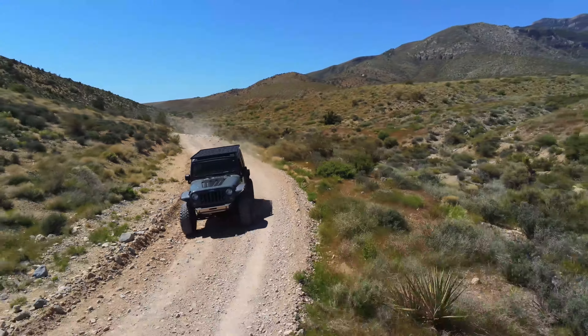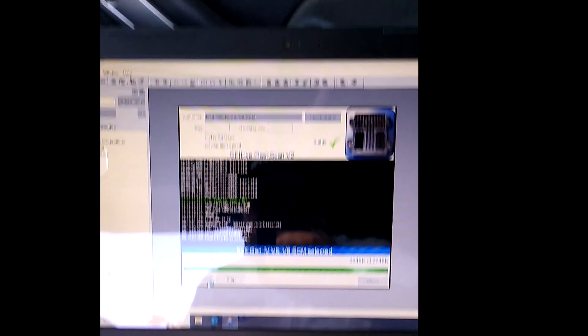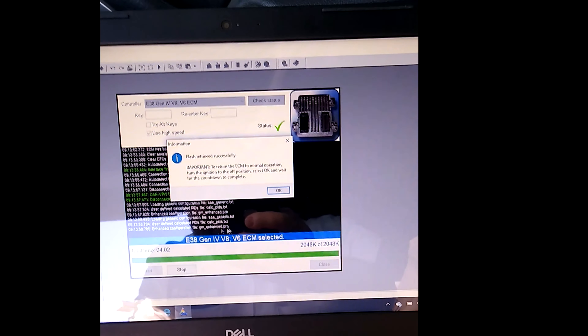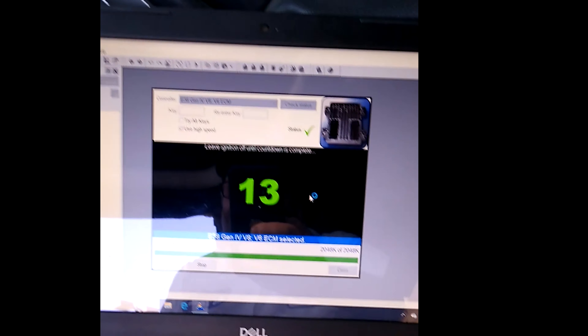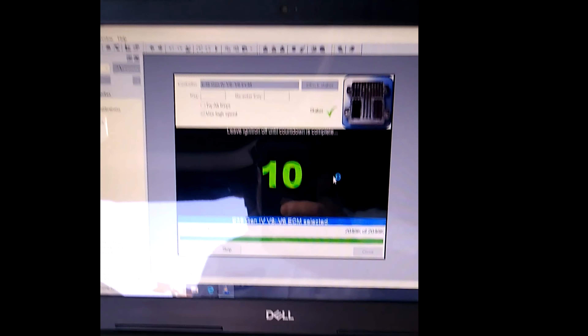So you went one or two degrees up on the spark, monitoring your knock sensor, monitoring your coolant temps, and monitoring your air-fuel ratio. When you're under a heavy load and you floor it, you're going to go into performance enrichment in open loop. The way you can make performance enrichment perform better is to bring it in earlier and add more fuel - there are settings in the tune for when it comes in.